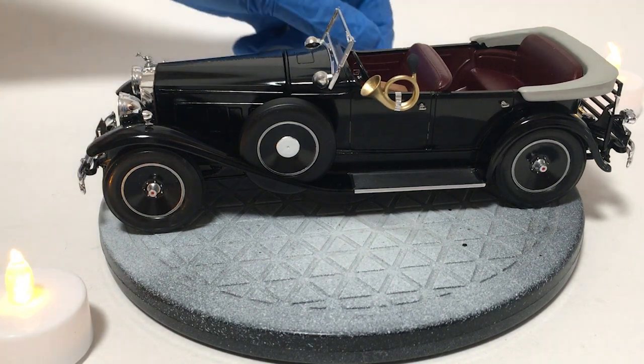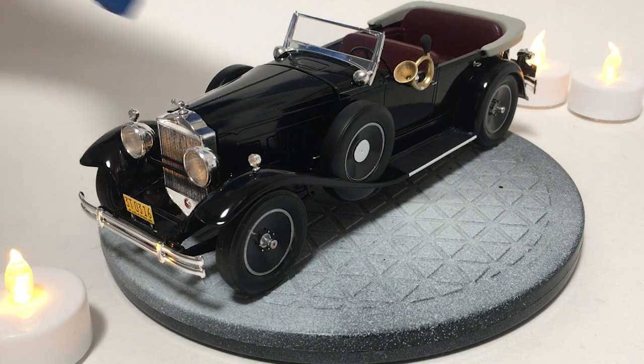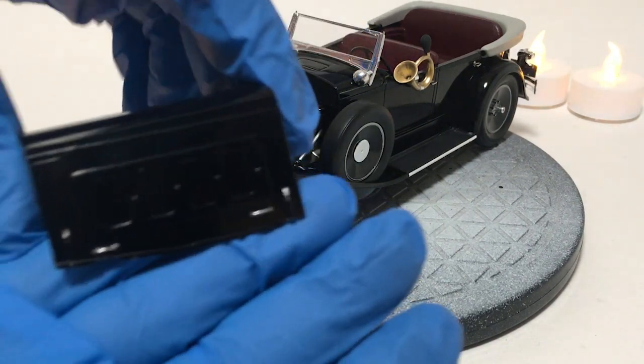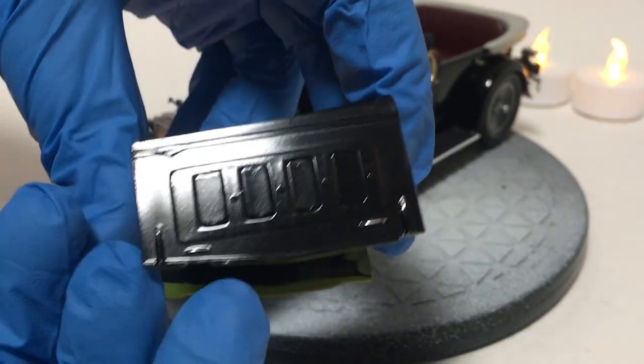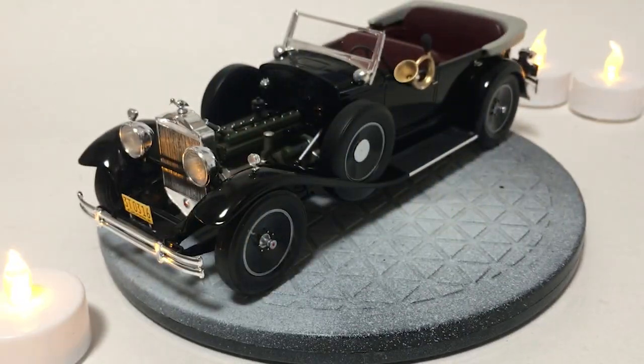Got the custom horn there, spotlights on the cowl. I'll take a closer look at some things. The other thing that wasn't quite right was the hood — it did not fit all that well. I had to notch it here and here on both sides before it would sit down like it's supposed to.